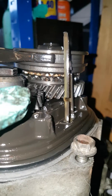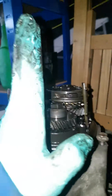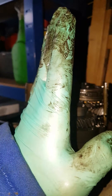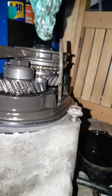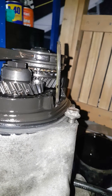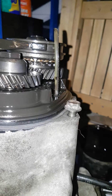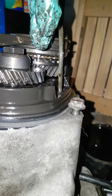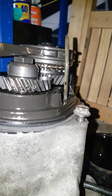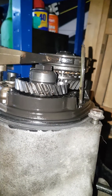What the synchromesh gears do — you might notice they've got arrows on them. Imagine two arrows like that and they link together like so — they slip in together. Whereas on older cars it was all straight-cut gears, and you might have heard of the term 'double-declutching.' Basically what that was, was where these synchronize the speed of the engine and gearbox to the speed you're going at, allowing it to all slot together smoothly. In the old days you had to drop it into neutral first, take your foot off the clutch, then put your foot back on the clutch, which would then mean that the gears would be pretty much at the right speed, and then you slot it in — but even then sometimes still got a bit of crunching. That's why we have all these synchromesh gears arranged this way, because it allows it all to slip together quite nicely and smoothly, giving you a really nice smooth operation.